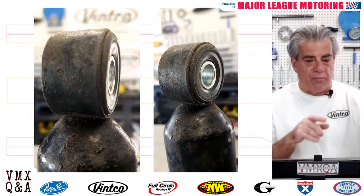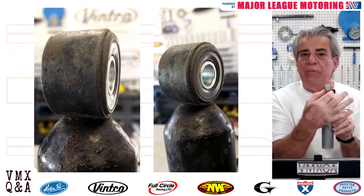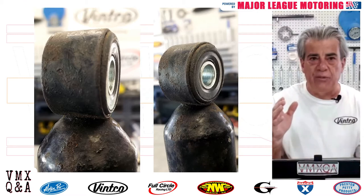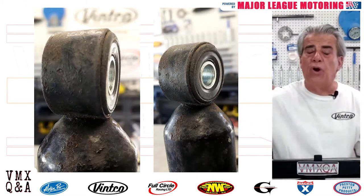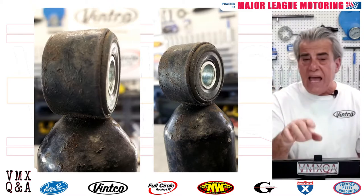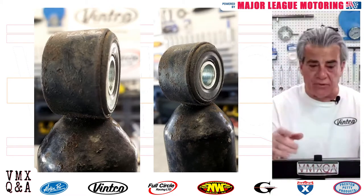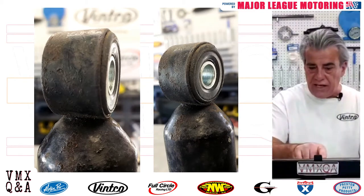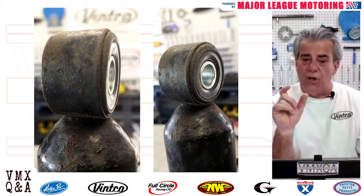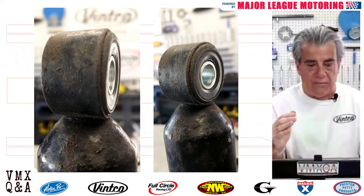When you're mounting a shock on your bike, if it looks like this and that steel bushing is not sticking out beyond the shock itself, that's where you need to be careful. That's what I was talking about — where people crank down on the bolt and it starts to pinch the shock. It usually happens when you're using a different type of shock or the shock is not set up properly, like you see right here. See where the steel bushing is not protruding beyond the rubber grommet or the rubber insulator — that's where you're going to have a problem.